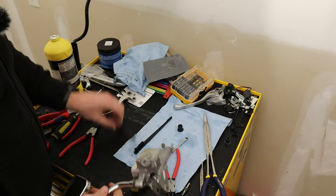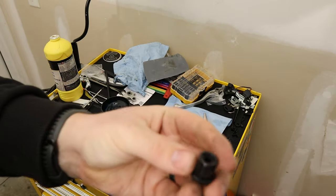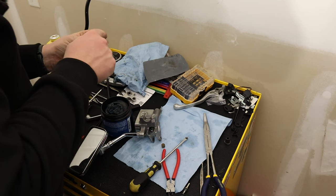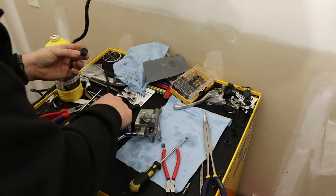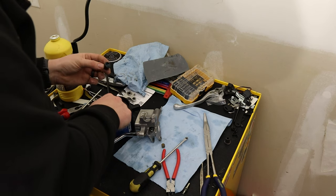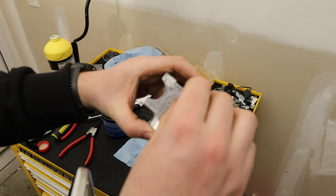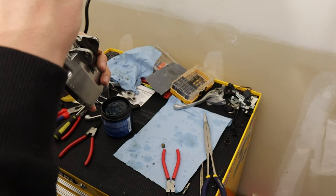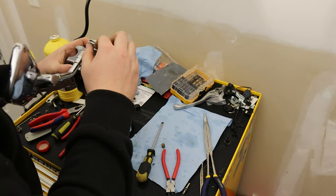The next piece — I've always done it this way and it's worked well — is I grab my boot here and pack it full with waterproof grease. This boot seals all of the inner workings from the outside and the piston runs through it, so grease isn't going to hurt it, only help it. Once you have your cup full of grease you want to seat it back — it's a bit of a pain to seat, but plastic tools would help. I think that's good.